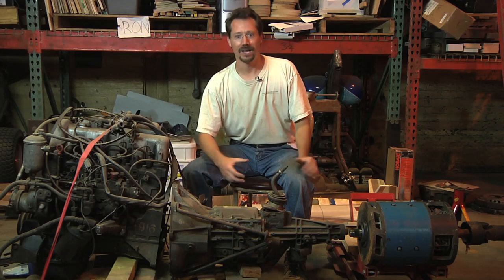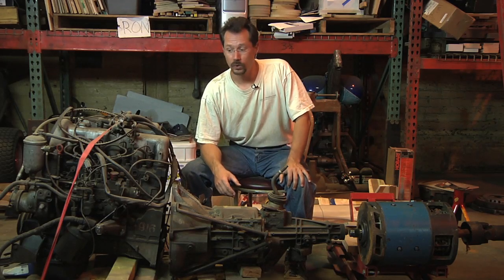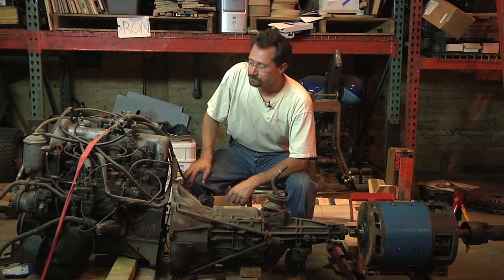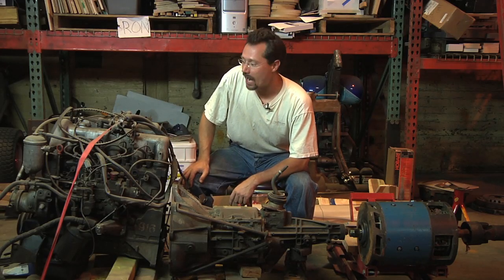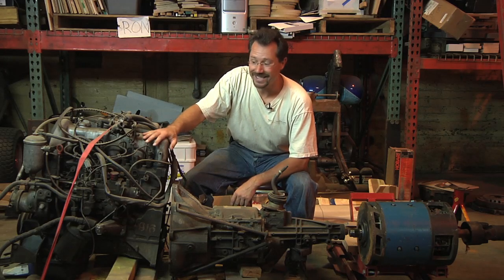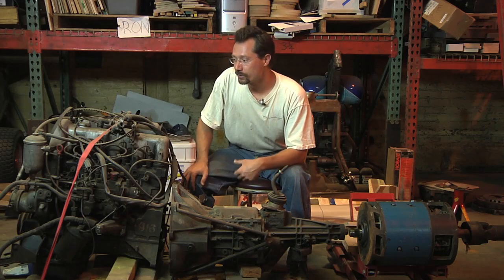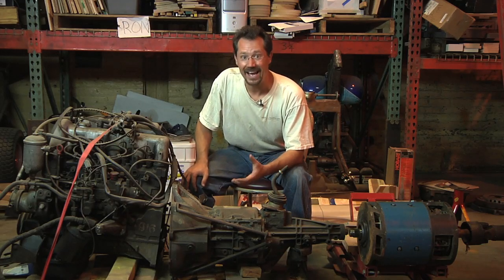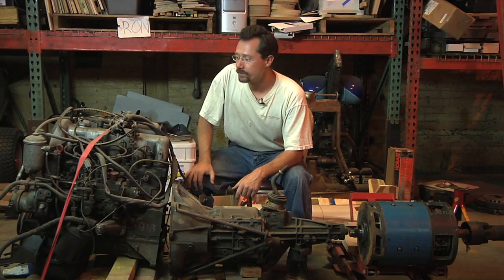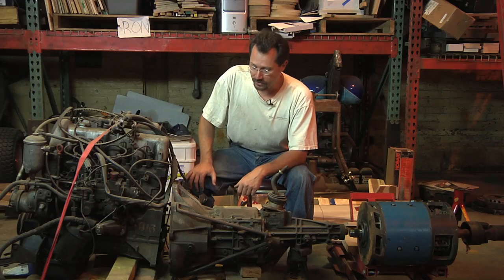But it's also going to be able to haul firewood, tow a trailer, and do all the other things that a truck can do. Here I've got a diesel engine — this is a 2.4 liter and it came out of an old Mercedes car, a 1981 240D. These engines are well known to be very reliable. They're very simple, not all computer controlled — it's mechanical, so it's very straightforward. They're also well known for conversions for biodiesel and vegetable oil systems.